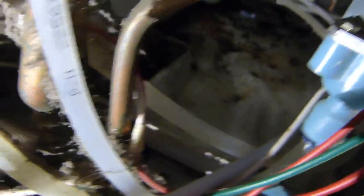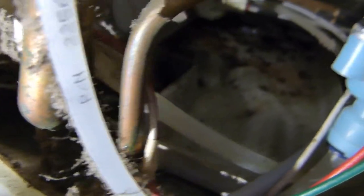What I did was come up from the back over here. Of course, unplug your freezer before you start messing with any of this stuff, and on the inside I had to take those panels off to get to it. There's the hole that comes up through, and basically your PVC plugs into this. When it goes through the defrost cycle it is supposed to drain into this tray down here — it's a pretty big tray, so it would take a while to fill up.